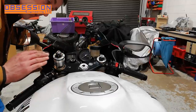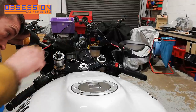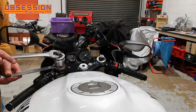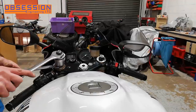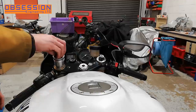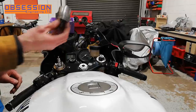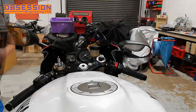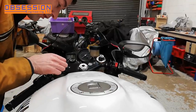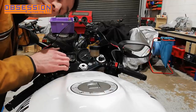As I'm undoing it I'm just trying to take some of the weight off the fork so that when we get onto the last thread it doesn't try and pull the thread off the top cap. It is actually a little bit easier with two people but all my friends have gone home. That has just dropped the front of the bike down and left the top cap pointing upwards, so I need to go and get a 17mm spanner.